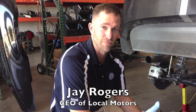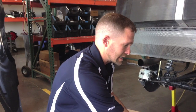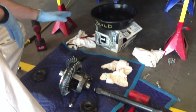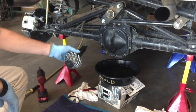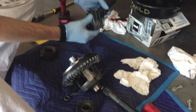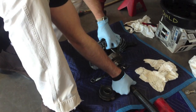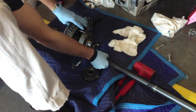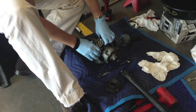I wanted to explain one of the great mysteries of rear differentials: the clutch pack. Here you have a rear differential broken out — the guts from the back of this axle. This is the differential housing on a solid axle. On the other side is a drive shaft going into a pinion gear, which links up to this ring gear. When it turns, it spins the axle and turns the wheel. So: drive shaft to pinion, to ring gear, to axle, to wheel. The engine's motion turns 90 degrees to spin the wheel.